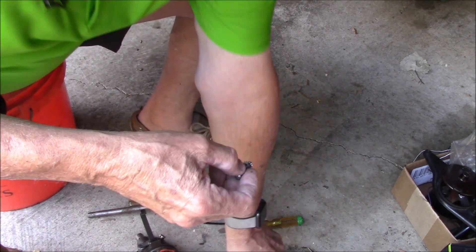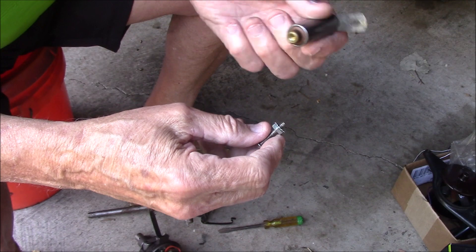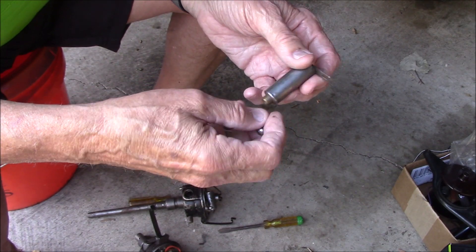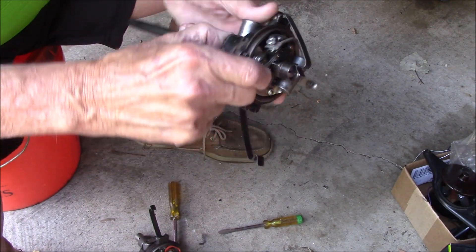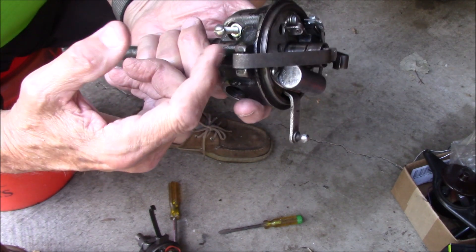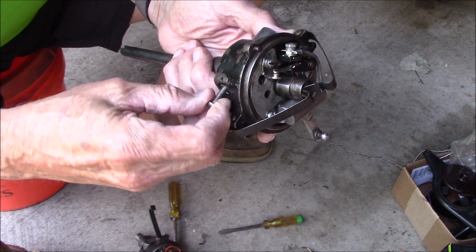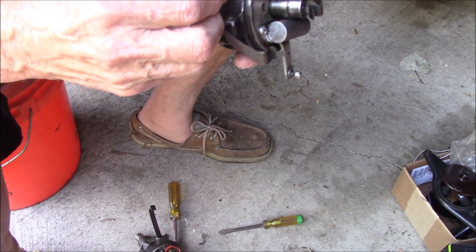The way you do this is pretty simple: find a screw that fits the condenser. If you have a standard condenser, double-nut the screw so when you put it in your distributor you can simply grab it. It's much easier to change a condenser on the road if you've got a nice long screw — double-nut it, goes right in, no special tool needed.